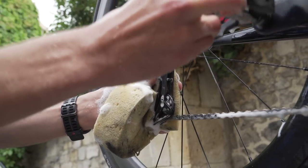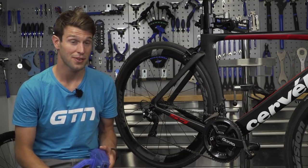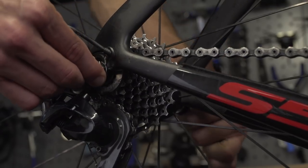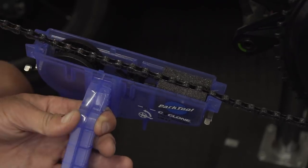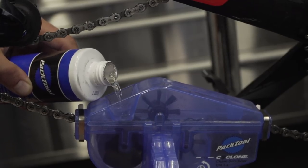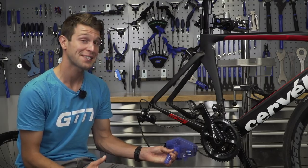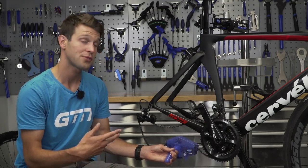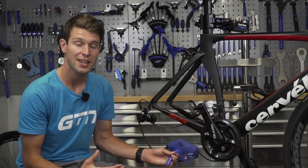Clean the degreaser off the cassette and derailleur, then head back inside to look at the chain. The chain is made up of intricate parts that ideally you want to soak to get thoroughly clean and running smoothly. Chain scrubbing devices are an absolute game changer for this. Remove the rear wheel, attach the chain cleaner to the bottom section of the chain, and make sure the chain is sorted in between the brushes. Fill the chain cleaner with a chain cleaning solvent up to the fill line, then rotate the pedals backwards for 30 revolutions. It's quite satisfying to see the fluid getting darker and darker. When done, remove the chain cleaner, pour away the fluid, replace it with soapy fluid, and repeat the process. Then remove the chain cleaner and wipe the chain down with a dry, clean rag.